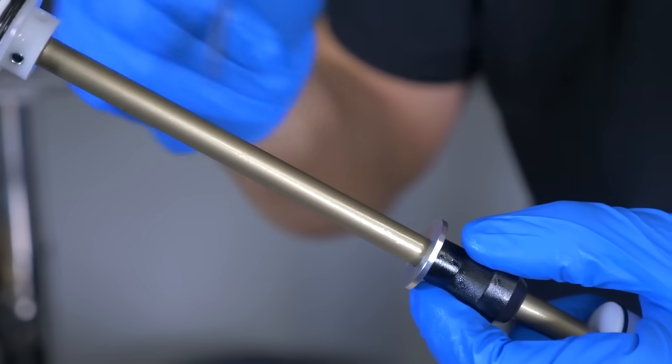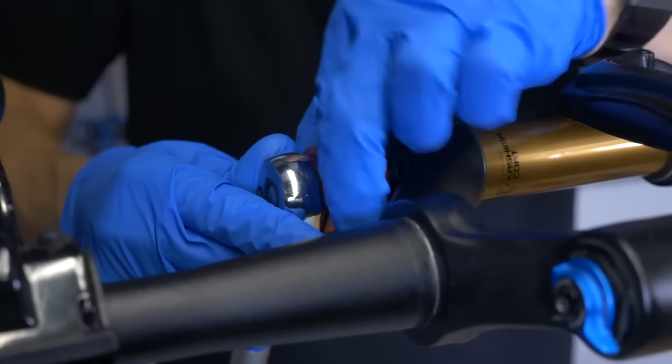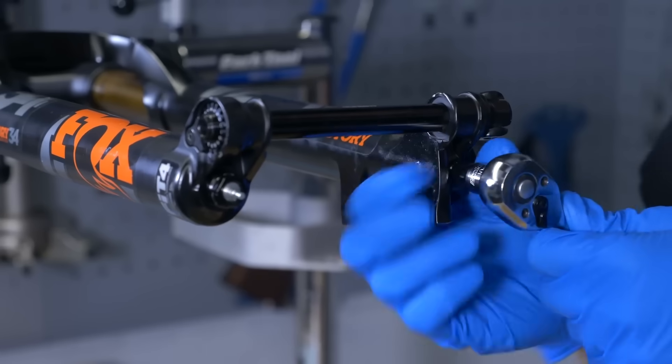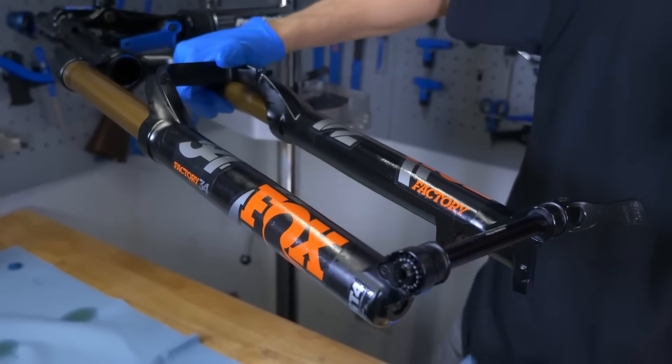If you feel confident, you can watch our video on how to clean it out and equalize your forks, or take it to a service center to get that cleaned up. Because you do have to adjust your pressure a bit if you change the tokens — you change the volume and Boyle's Law means you have to bump the pressure up to get the same amount of sag. You can't just return to your old pressure settings, but it wouldn't be 20 to 30 PSI, just a couple of PSI. It really shouldn't be affected by adding or removing tokens. Take your forks apart, check there's no grease in the wrong place, or get them serviced.